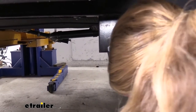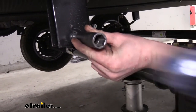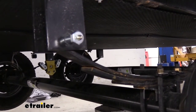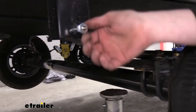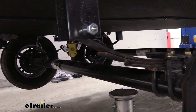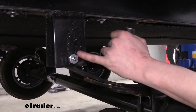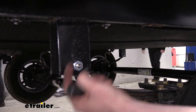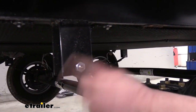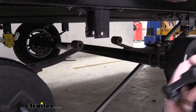We're going to put the fittings on the outside since they're easily visible on this trailer. Once you get it started, it is new so it'll be just a little bit snug — just tap it in gently. Make sure you don't hit the grease fitting in the middle, so put something over it like a socket. After you've driven it in so far, lower the axle down, check on the inside to make sure the holes line up, then continue driving it in. Once it's almost all the way in, the splines on the head of the bolt will make it difficult — put your nut on and tighten to fully seat it. Check that all bushings are flush, then we're ready to put on the new equalizer.